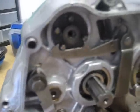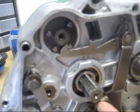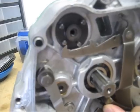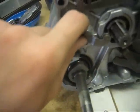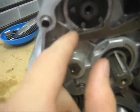Here you can see what's behind the shift star. These are the pins. Now you can see the shifter. Oops, hold on. Normally the shift star would prevent it from doing that. Okay. So now this will pull it back, and the shift star would allow this to ratchet by holding this back, and also the spring-loaded wheel, which is not spring-loaded right now, would hold this in place so that this would not push it back when it tries to ratchet.